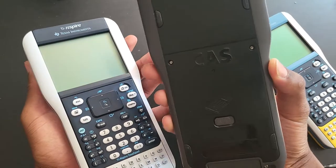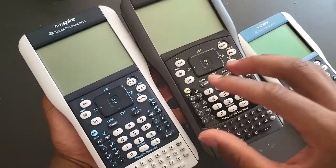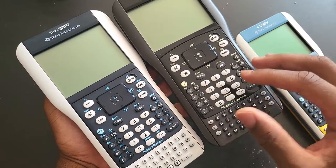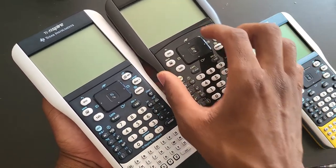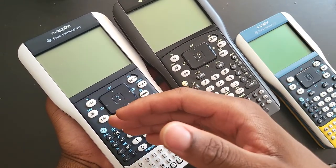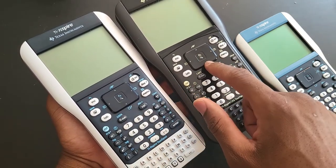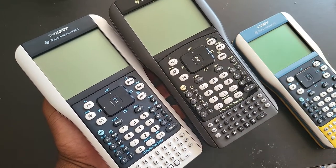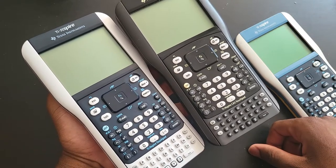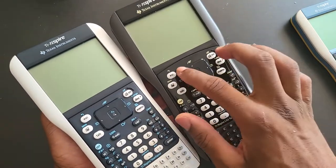Something I wanted to point out: the keyboards on these two are not the same. The circuit board is the same size and everything — they would even fit on each other — but it's not going to work. If you take the circuit board of this keyboard and put it in here, it's going to show you a TI-84 Silver Edition and won't work. And if you take the circuit board of this one and put it in here, it's just going to give you a warning message asking you to get a certified keypad from Texas Instruments. TI did everything to keep you out of it — they even have different designs.